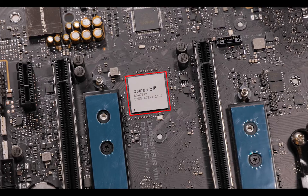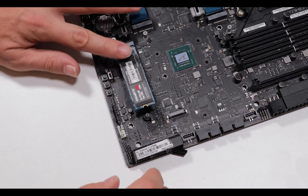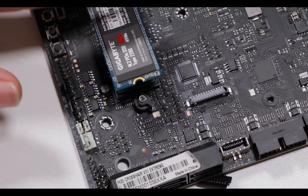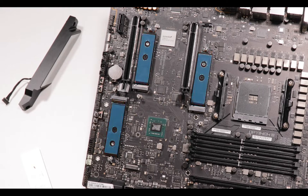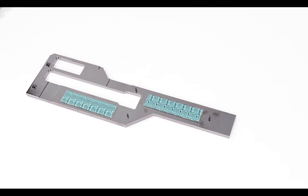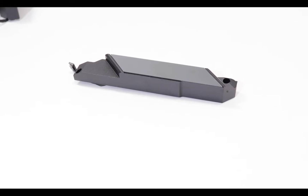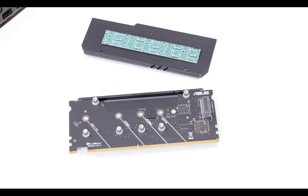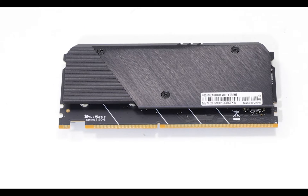Notice this little chip — a dedicated packet switch which is really important in keeping all that data neat, organized, and flowing properly. Also worth noting is the ASUS Q-Latch locking mechanism, one of my favorite small yet important developments we've seen in the past 12 months. M.2 drives can get really hot really quickly, but thankfully all five M.2 slots have been equipped with large thermopadded heatsinks — and when I say large, look at those things. Even the DIMM.2 sticks come with their own dedicated thermopadded plates. No thermal throttling here.